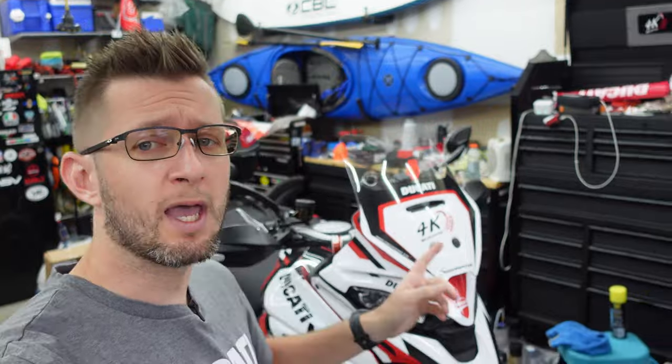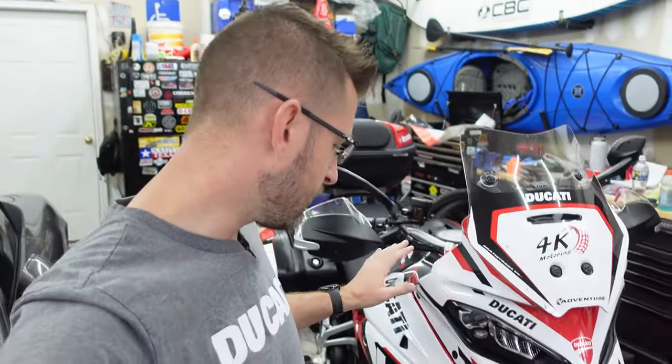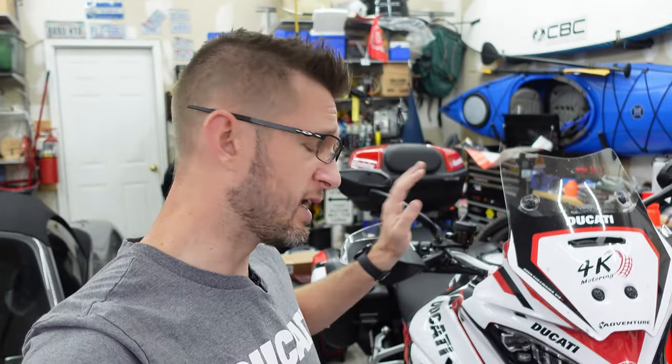That is what we wanted — a locked system that's not letting any air into it. Nothing too crazy; it was a pretty simple fix for this 2022 Multistrada. I know a lot of you have asked what the fix was because you're having similar issues — overall it was a diaphragm tear in the front master cylinder, and that was it. It's a pretty complicated brake system with potential for error elsewhere, but on this bike it was just that small rubber diaphragm tear. If any of you are having other brake issues, I'd love to hear about it down in the comments.